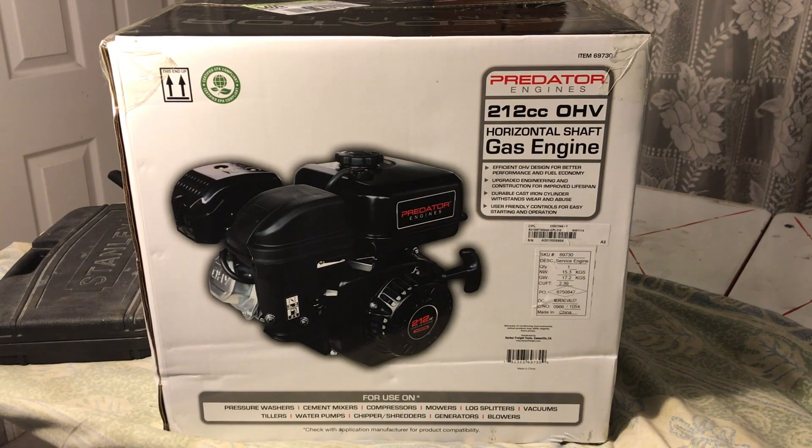A little information about it. The non-hemi — I would mainly get the non-hemi if I'm planning on spending a little bit of money on the motor. If I'm going for a really budget engine, I usually put a Hemi on there. The non-hemi comes with a dish piston, you'll see that later in the video. The Hemi actually has a complete flat-top piston, which is one of the better things of the Hemi and one of the reasons people buy it.